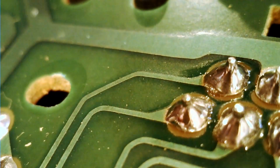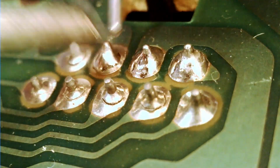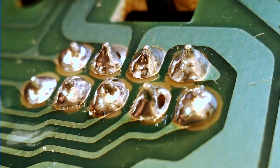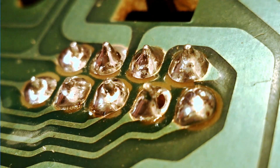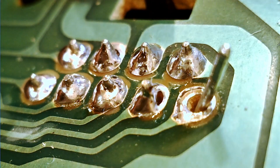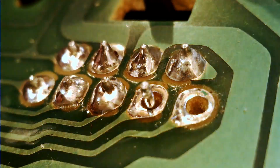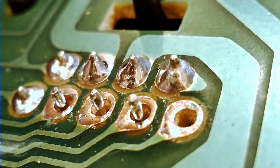On port two there are problems with the pins being misaligned, so I decided to remove the port to make it easier to work on. I added fresh solder to each joint. Notice the bottom right pad isn't cracked — unusual. As I add solder to it the pin does a disappearing act. When I apply the solder sucker, it does such a good job it sucks the broken pin right out. By the way, I'm using an Engineer made-in-Japan solder sucker as seen on Gadget UK. It's a little more expensive than your regular nylon-tipped sucker, but I can't recommend this enough — it's simply superb.